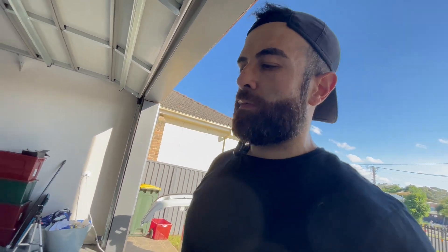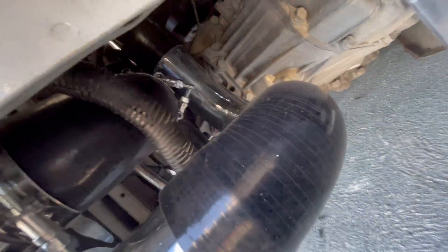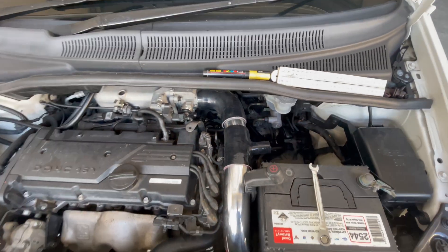The intercooler is done. I'm going to take the cold side pipes off and clean them up, just make sure there's no bits of aluminium. It goes from down here, loops, goes back up — you can see that pipe there, no clamps on yet — and it comes out here. I have put a provision for a blow-off valve. It's easier to put one in and block it than try to add one in the future. Blow valves are cool if you don't have flutter — depending on the air intake I fit, I might go that way.